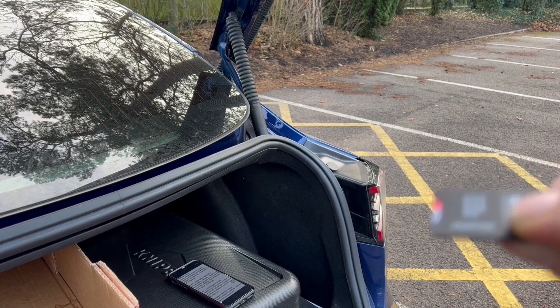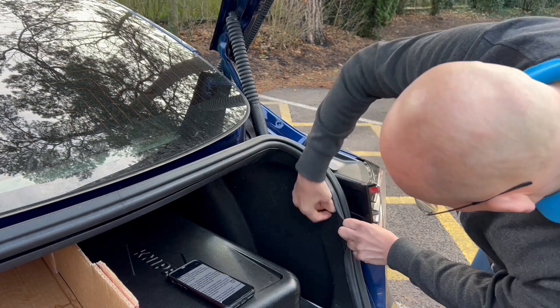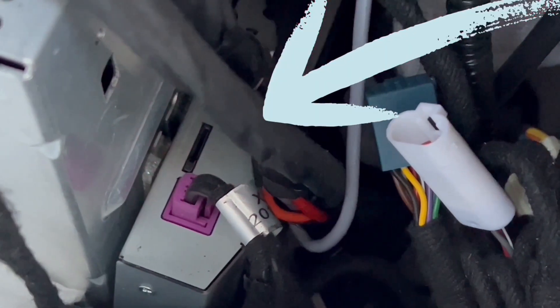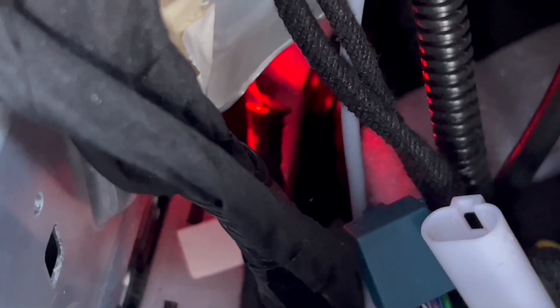Once you've got your SD card with the micro SD loaded, we're going to flash the actual software. Get to the control module — it's behind here. By the pink plug is where you put the SD card. Insert the micro SD card into the control unit. The red LED will flash rapidly, and when the LED becomes static, the software is done. Push it in — it's flashing fast — and when it stops flashing, the software's done.